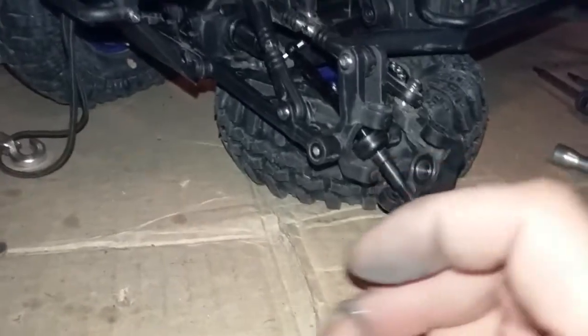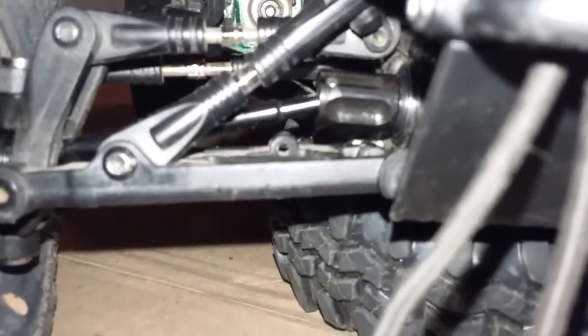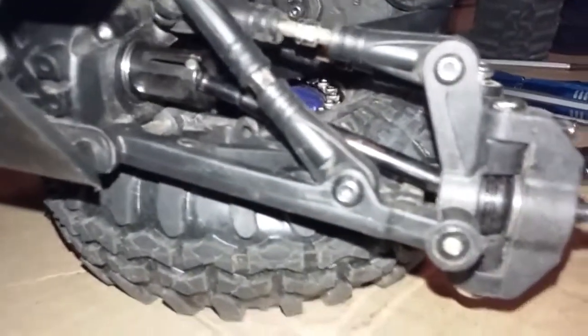It's been apart and back together about 30 to 35 times. I just keep sanding this little washer down trying to get it just right so there's gonna be enough gap to get the pin through at the end. A couple more minutes — I don't know if you can see that hole there but it's almost there, I need to sand down just a pinch more. Hopefully that drive shaft won't come undone up there anymore. I didn't have a problem with the passenger side — it kind of stayed together and seems to be seated a little bit farther in than the driver side.